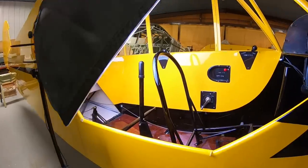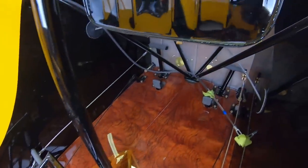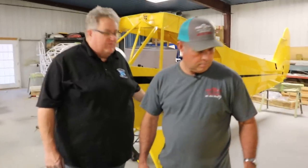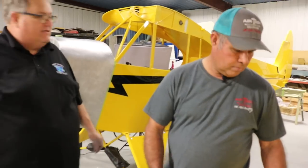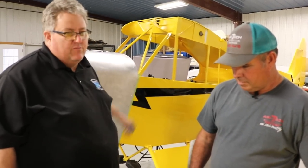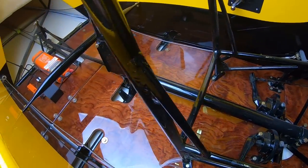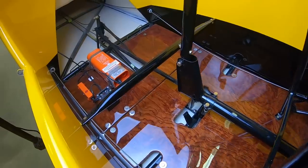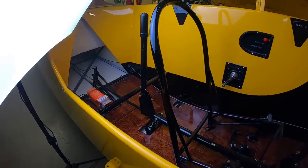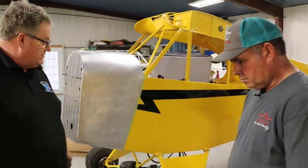Airtek. I think he's wanting it kind of the original type. I'm Brian, owner of Central Arkansas Aircraft. This J3 is gonna be pretty period correct — he wanted everything other than the floorboards. We're using period correct hardware, slot-headed screws, it's a 65 horse. The stripes are laid out according to Clyde's drawing, so it's gonna be pure Cub. No other custom modifications other than the floorboards.